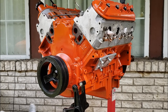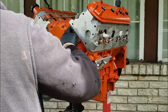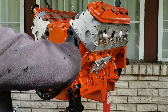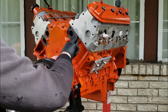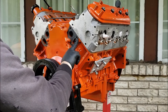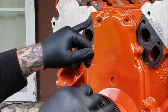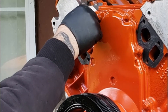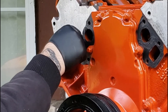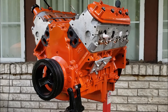We got the water pump done. Go ahead and put silicone around this, and try not to get any in the hole itself. If you do get some silicone in that hole, you need to clean it out — it can cause fitment issues, it can cause you to crack or break the bolt, or even crack the block if you get enough silicone in it. So just a light coat and don't get it in any of your threads. If you look, we got a little bit of silicone in the threads — just take something and get it out. We are ready to install the pump.